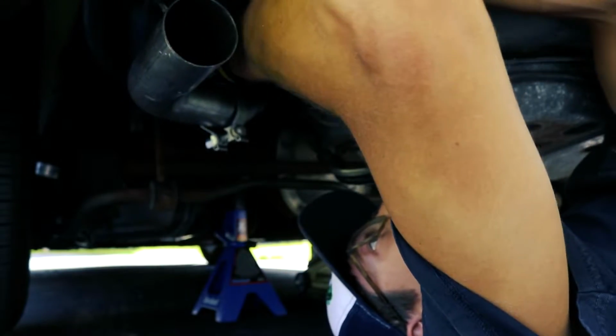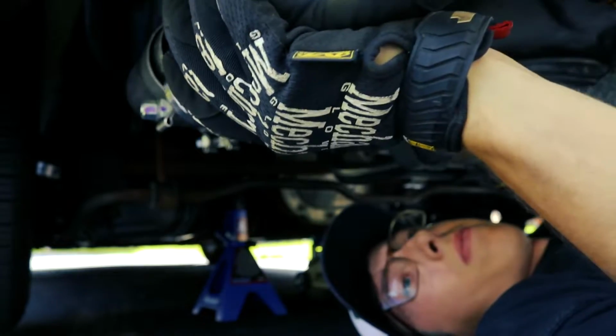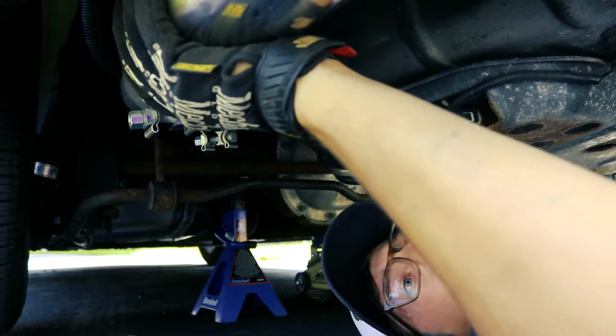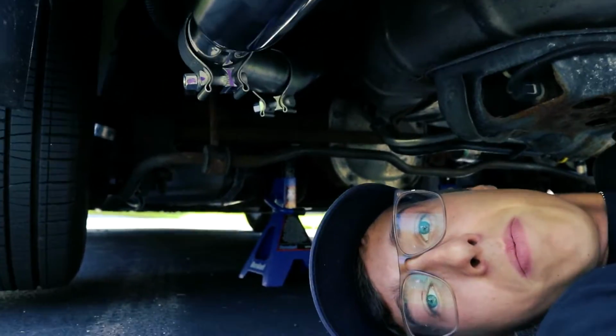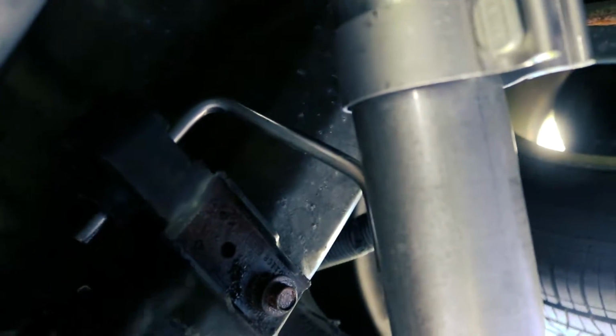All right. Doing the hangers really loosely really helps right off the bat. So like you get the bolts threaded, but you don't tighten them down at all. All right, let's check this out. This is the part that goes to the over axle. I got that on, clamps hanging, ready to go. Hangers hooked on, hangers on loose.